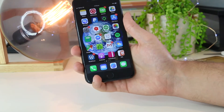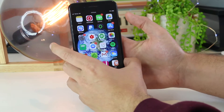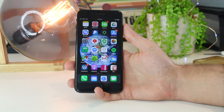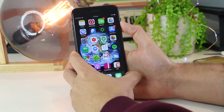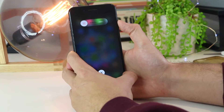If you have the iPhone 7, you can restart your device by pressing the volume down and the lock screen button together for around 30 seconds. And if you have the iPhone 8 or above, you can restart by pressing volume up, down, and the power button in quick succession. This will go ahead and restart your iPhone — just keep press and holding.